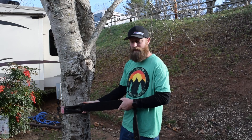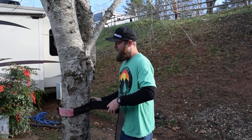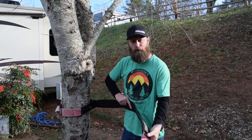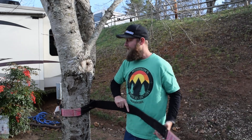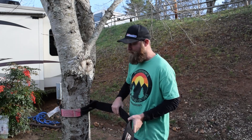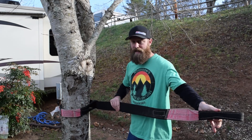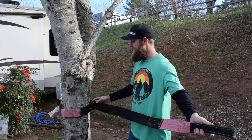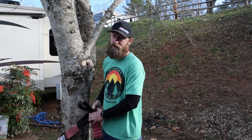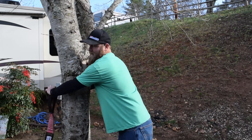You want to make sure it goes flat all the way around the tree with no twists in it — that flat friction is what holds it. Instead of letting it come straight back to the vehicle, let it come off the side of the tree and point back toward your vehicle so it's not cinching down and girdling the tree. You'll also gain a couple extra feet this way, but there is strength loss with this configuration, so keep that in mind.